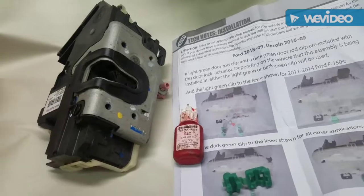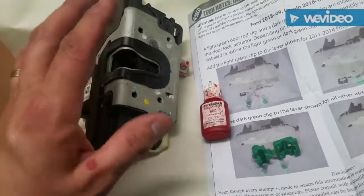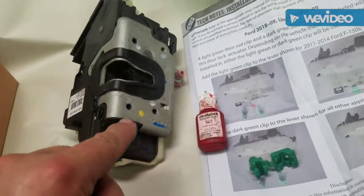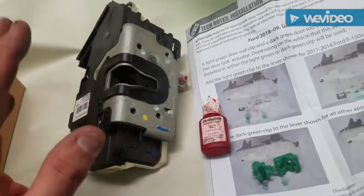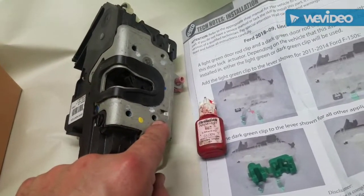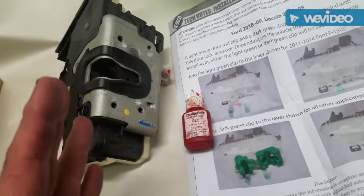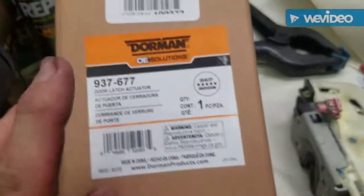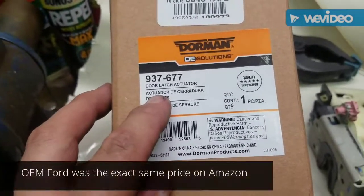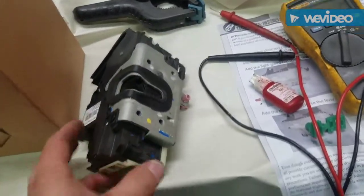I got it to work. What I did was: I bolted it up to the door, shut the door without tightening anything, then slowly opened the door, put some Loctite on one bolt and tightened it real tight, checked the ignition — still working fine — opened and closed the door again, then tightened another one, did the same, then tightened the third one. There seems to be very little adjustment if any on the door itself. The part number is 937677. It seems to be working now — and it does have a lifetime warranty, so AutoZone will get it back if it fails. Then I'll go with the original Ford OEM one.